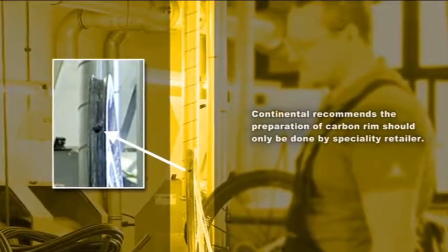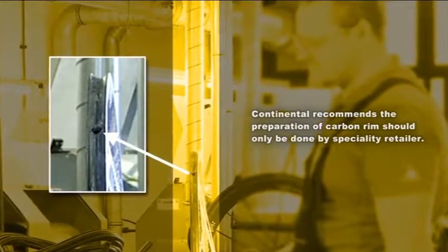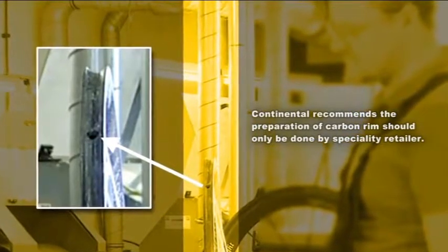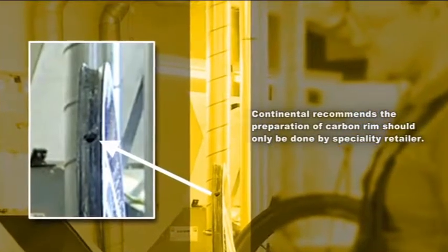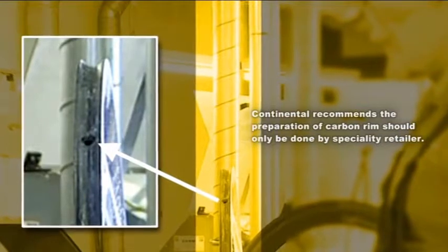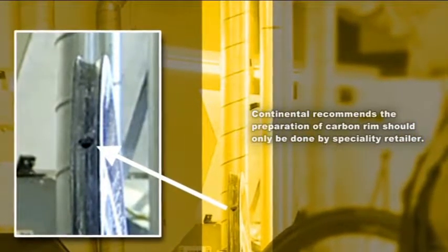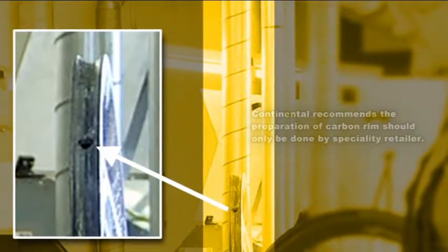The valve hole in the rim is often not cleanly deburred, which can result in radial runout or even damage to the tire. If this is the case, deburr the valve hole of the aluminium rim using a round file. If this is done, the valve area clings to the rim better.